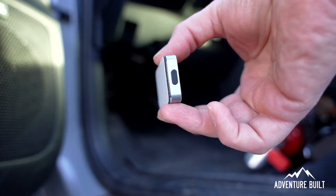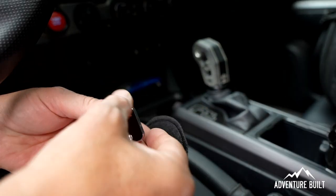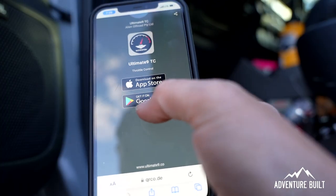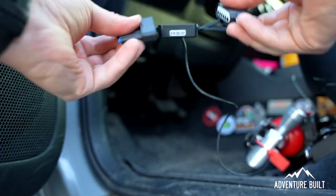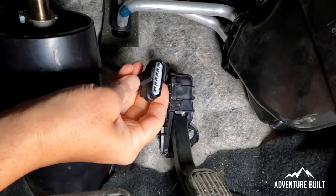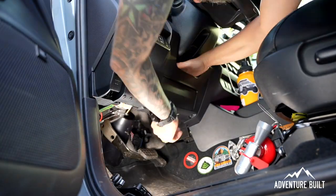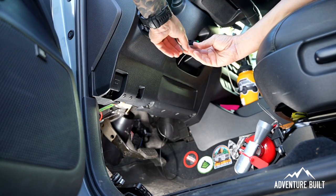In the box you have your control module. You also have your wiring harness that plugs into the pedal. And you get a cool little carrying bag for your module because you don't need to have it plugged in. Downloading the app is super easy — all you do is open up the guide and put your phone over the QR code. Now that I've got the app downloaded, I'm going to install the throttle controller on the pedal itself. All I'm going to do is disassemble these two pieces here. One end goes into the top of the pedal on the Tacoma, the other end goes into the wiring harness that originally went into the pedal. And then your USB-C cable that comes out of the Ultimate 9 goes right into the Ultimate 9 module.